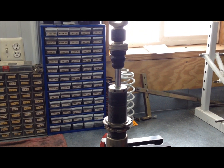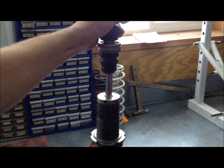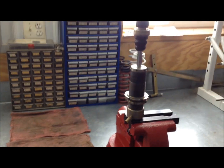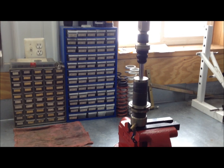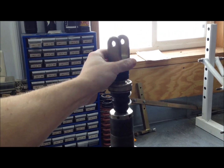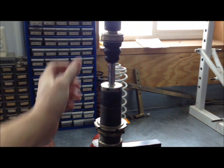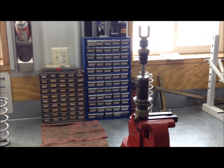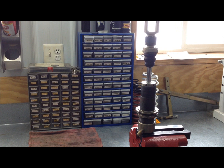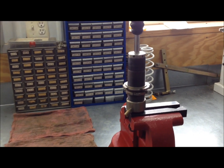How do I know if it needs oil? Well, it's pretty simple. Here's a shock with no oil — real easy to show. This is what a shock does without oil. Or if it has partial oil, you'll hear air bubbles squishing back and forth. What it'll do is return up to a certain point, and then the last part it'll shoot back out. So you know you're low on oil.